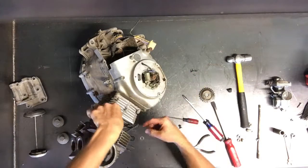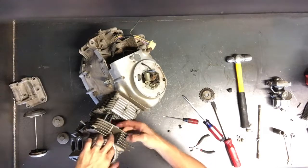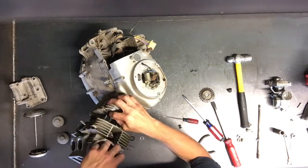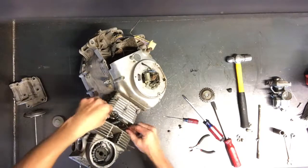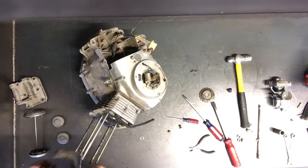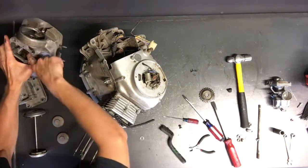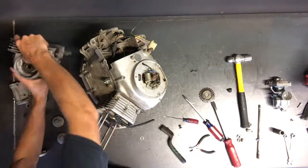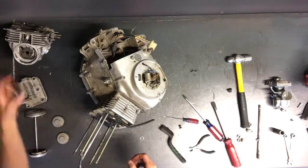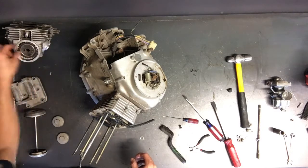You could also find the connecting link down there and remove it that way, or just pull it up far enough to where you can get to it with your hands — you might have to spin it to find the connecting link. Now we'll finish pulling that head off. There are the valves there, the cam is inside of it — we'll put the sprocket back on and sell that all together. Here's the sprocket that we took off, and there's the timing mark on the cam right there.